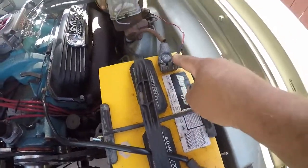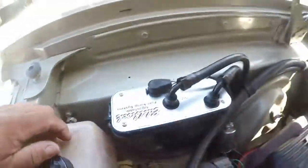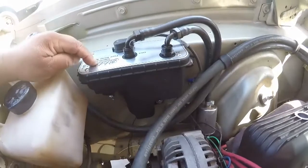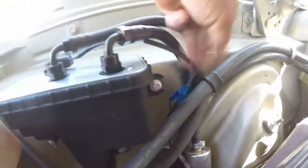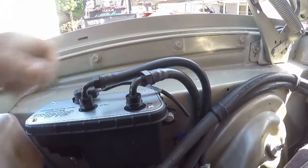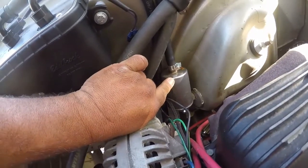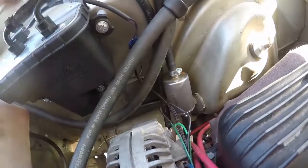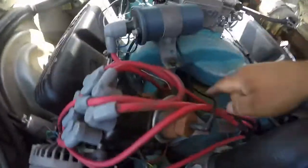You have to have it on the battery. This will get cleaned up, of course. And the fuel system setup, it's the Edelbrock Sump kit, which does not require a return. Had to just make this connection here. Made these lines. You put these in hot water and they'll just slide in, no problem. High pressure fuel injection filter. It comes out the command center, goes in, goes through. I ran it under the valley here and it goes up here.